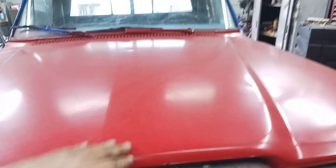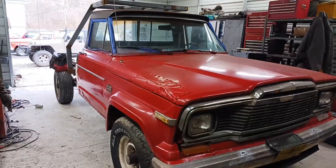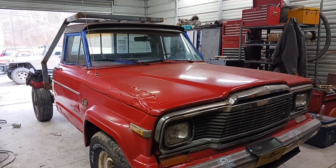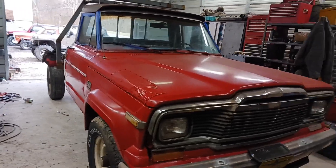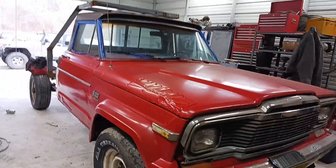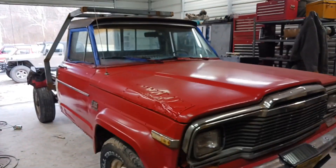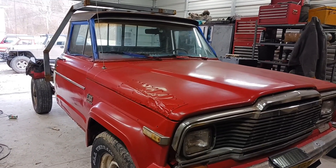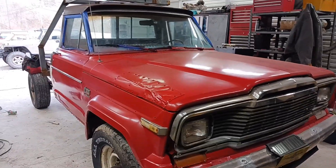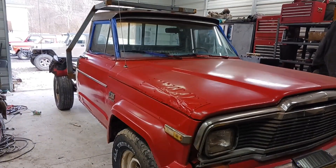Fire your Jeep up and verify with a multimeter that you're charging. What we'll probably do in the future — I just don't have one on hand right now — is put a volt gauge in there so we can at least read something. The only good thing about this truck is the wiring hasn't been too terribly torn apart, and I really didn't want to split the loom and run non-factory wiring. For my purposes and this truck, that's a perfectly acceptable way to bypass the ammeter.